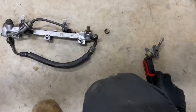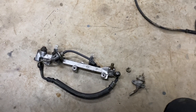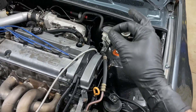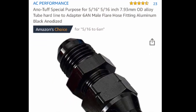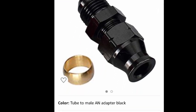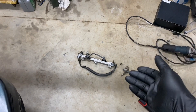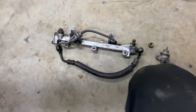Basically what you can do to get around this is get rid of all of that. In order to do that you would disconnect your stock fuel filter, which is behind your motor in a really annoying spot. You disconnect that fuel filter, chop the line off — you don't even have to take the filter off — use a compression fitting, and then you can run an aftermarket fuel hose, whether it's rubber or PTFE, to a high-flow fuel rail.